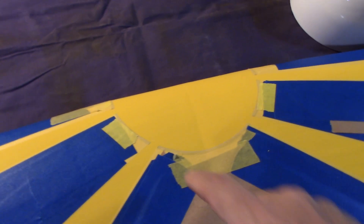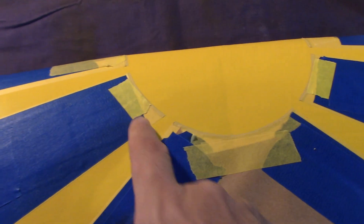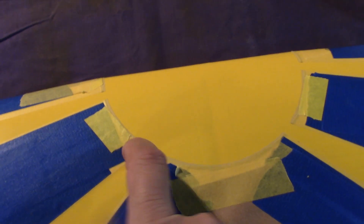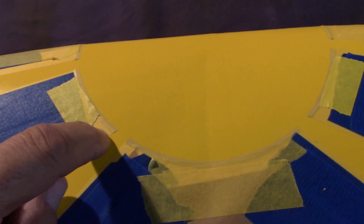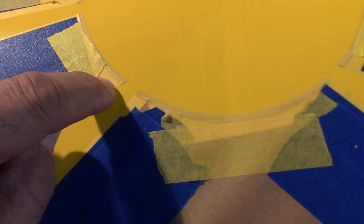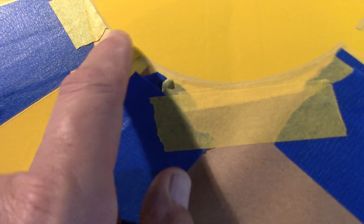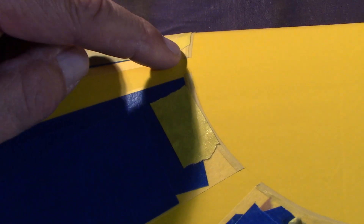The interesting part I'll have to go through before I push the button the first time — every little seam where I'm going from the fine line to my regular frog masking tape, I'm going to come in with a fingernail and just burnish that in. That way there's less chance of a bleed-under at that point. That's why I don't have any tape going right up to the edge — I need to get my fingernail in there and burnish each one of them.